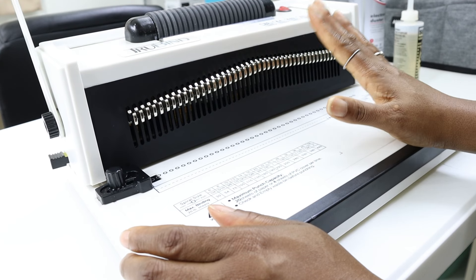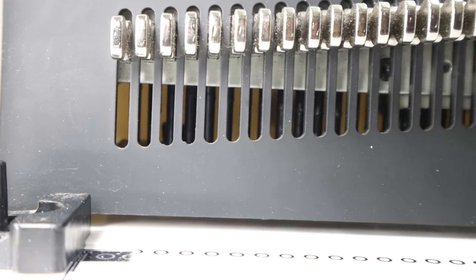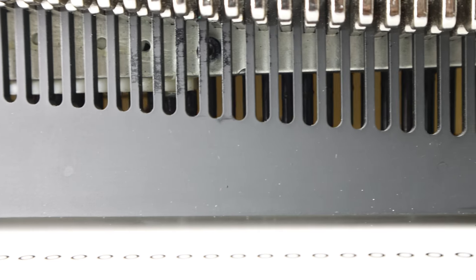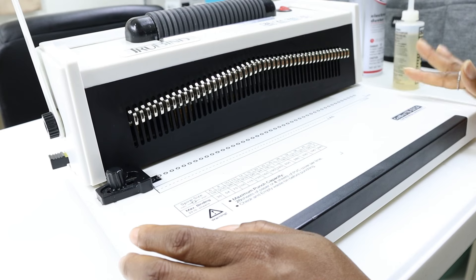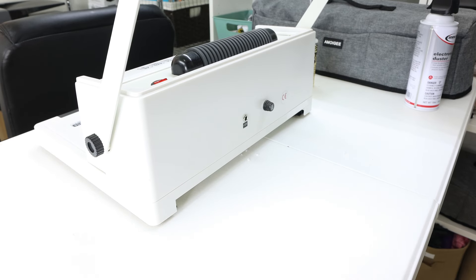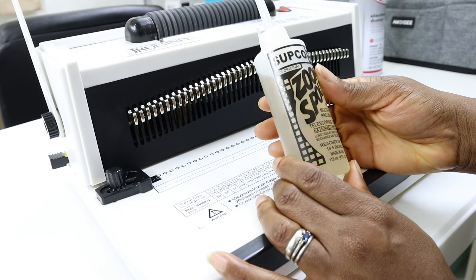I've meant to oil this machine for a long time, but honestly I've owned it for six years and never oiled it. I did notice a bit of buildup along the die spokes on the inside, and this year when I was binding books I noticed a little bit of resistance even though the tray was empty. I'd like to get another six years out of it, so I'm going to clear out the tray, dust it out, and also oil the machine using turbine oil.